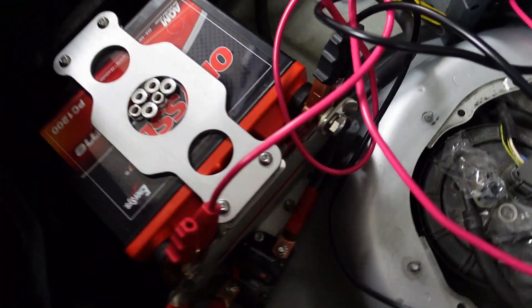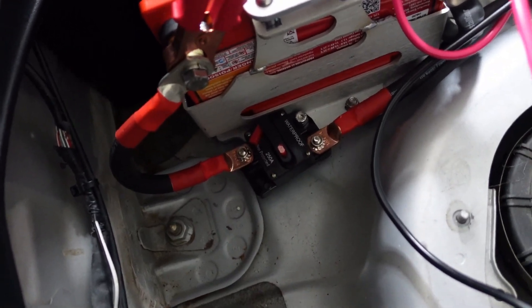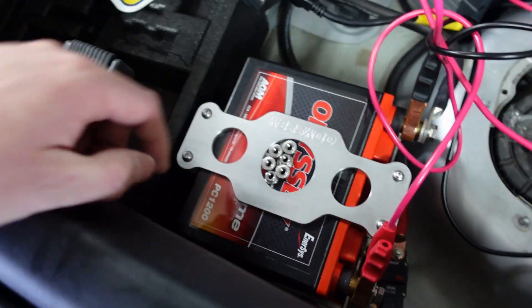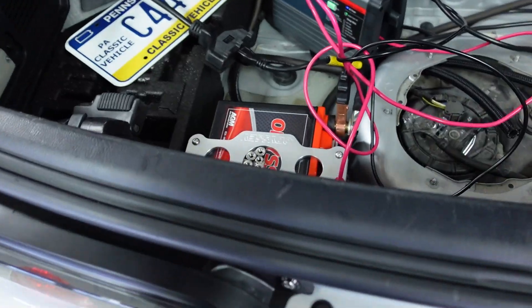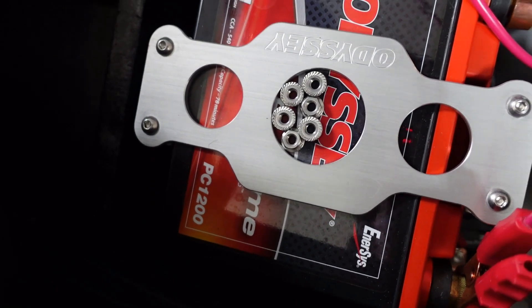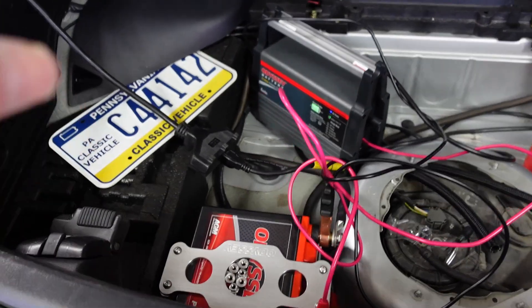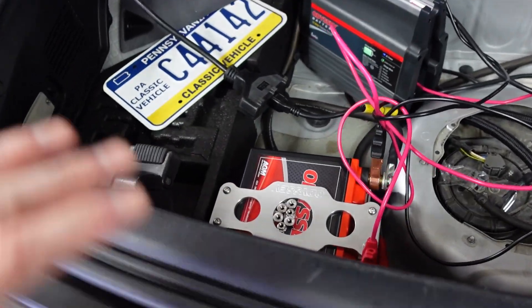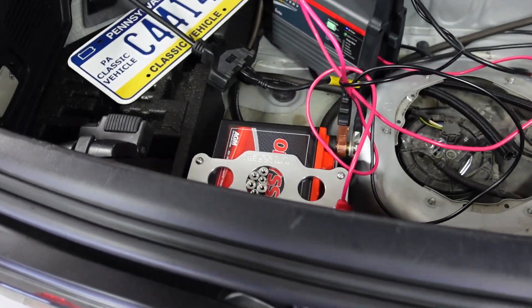I'm charging up the old Odyssey battery now — this is what I need to replace; it was bad on her car, so I grabbed the one from her car and put it on and I'm just charging it up right now. This is the Odyssey battery setup — I made a video on this, I did a pretty cool little setup on this. I did it on her car, my car, Mike Bulk is doing this setup, and Colton is also getting it. It's cheap, effective, and it works. This battery bolt down comes from Odyssey also. One thing I want to make sure of: if you have your battery low when you go to start your car with those high output alternators, it can cause some serious issues. So make sure your battery is always fully charged and good to go. I just want to go ahead and give it a trickle charge — it's sitting here not doing anything anyways.